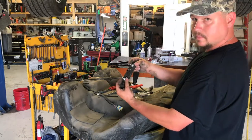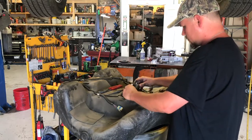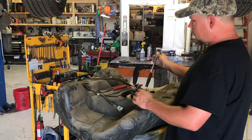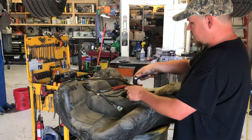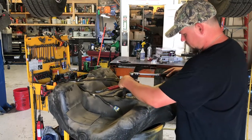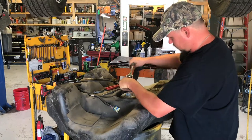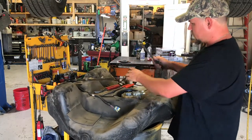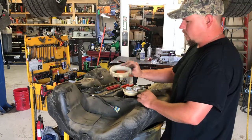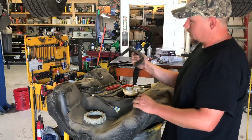I'm going to show you how to use this tool and figure out what happened to this pump. Here we're just going to size up the tool — loosen up the butterfly nuts on the tool, get nice and close, grab a pair of pliers, give it a little more snug so nothing moves. I'm going to be using a ratchet with a 14mm socket to take this cap off. Remove the cap — no damage. We didn't use a pick or a hammer to take this off. There are special tools that do this job correctly, and this is one of them.